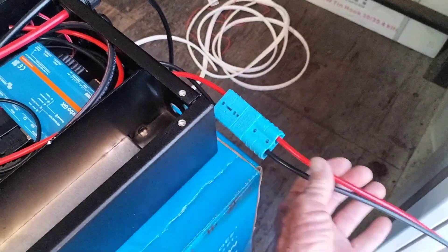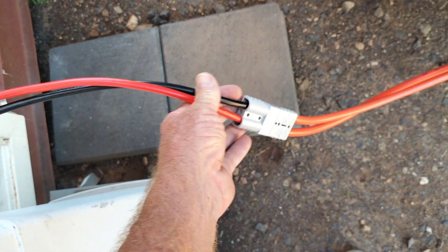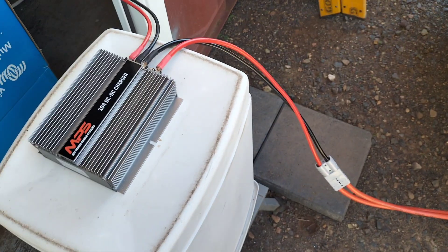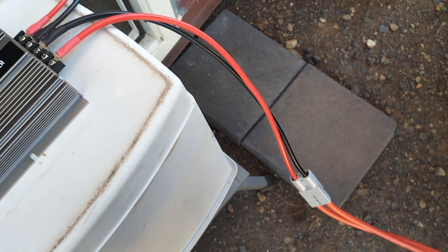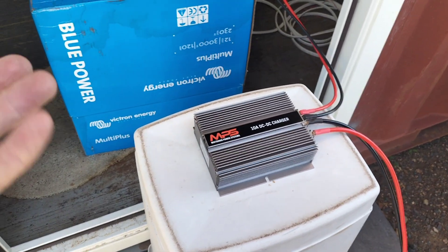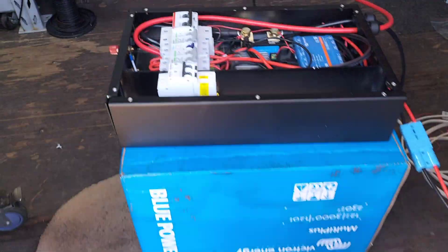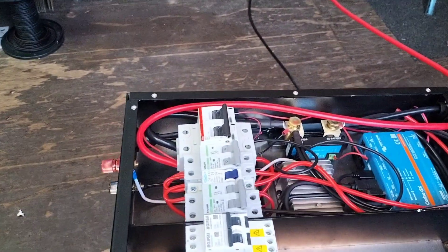I've got it set up on an Anderson plug to make life easy for her — Anderson plug into the breaker box, and Anderson plug on this end into her bus wiring, so she can get an auto electrician to wire in an Anderson plug off the alternator. No need for voltage-sensitive relays.